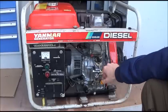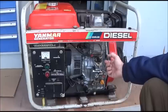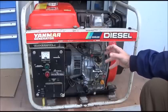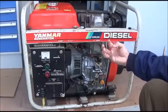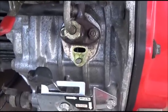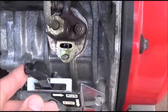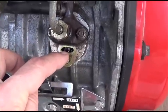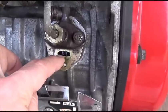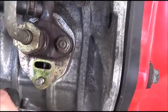With the trap door removed, we're looking for a small needle inside. As we adjust the throttle we can see the needle moving if the plunger is not stuck. If the plunger is stuck, we know we have a problem and must unfreeze it. If it is frozen, it's usually going to be frozen in the position where the needle is to the far right, meaning the plunger is as far up as it can go, not allowing any displacement.